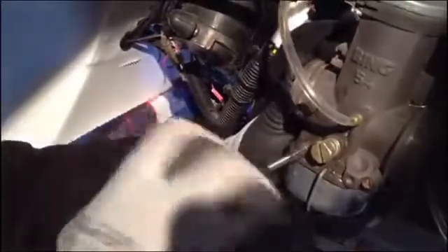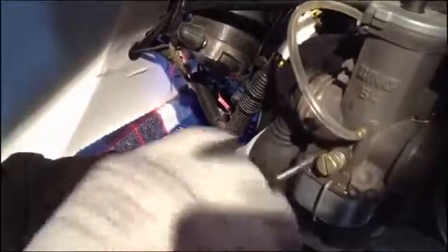I'm at the end of where I started the thread already, so now I'm going to go back and use proper tapping procedures. I'm going to turn it a bit and back it, turn it and back it — cutting thread right now. That's standard tapping. Now it's stiff to turn — it could have filings packed behind it, or I might be at the bottom of the hole. So let's remove the tap, clean the hole, and see where we made it to.